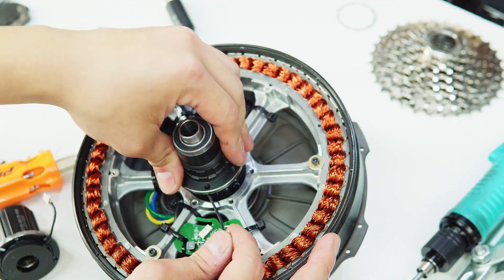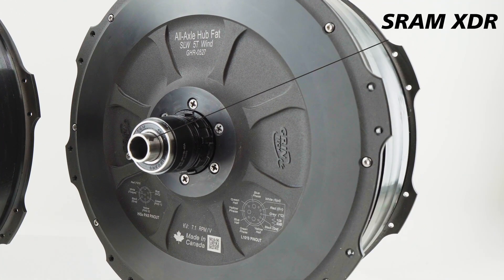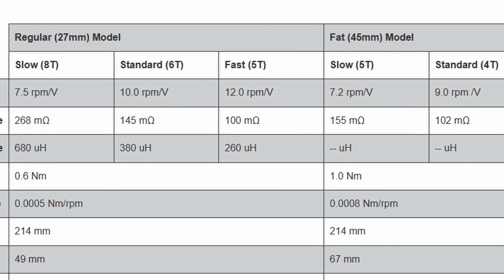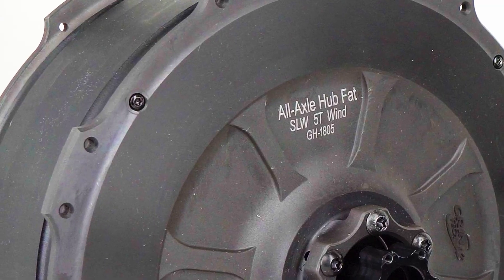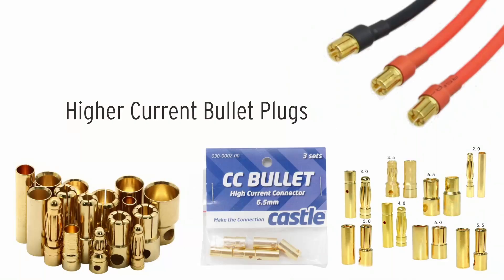Like our regular all-axle rear motor, the fat version also comes with an integrated torque sensor in the cassette drive. There are options for a Shimano HG compatible cassette — the standard found on most bikes — as well as a higher-end SRAM XDR option for super wide-ranging 12-speed bikes. We produce this motor in two different winding speeds: a slow and a standard wind option. We don't produce a fast wind motor because the phase current necessary to produce adequate torque output would end up melting the XT60 connector, which is currently the bottleneck in how much power you can put into this motor. To maximize torque and power output, we recommend the slow speed winding option and choosing a high enough voltage battery pack to achieve your targeted road speed. Alternatively, you can cut off the connector and re-terminate the wires with a higher-current bullet plug or similar.